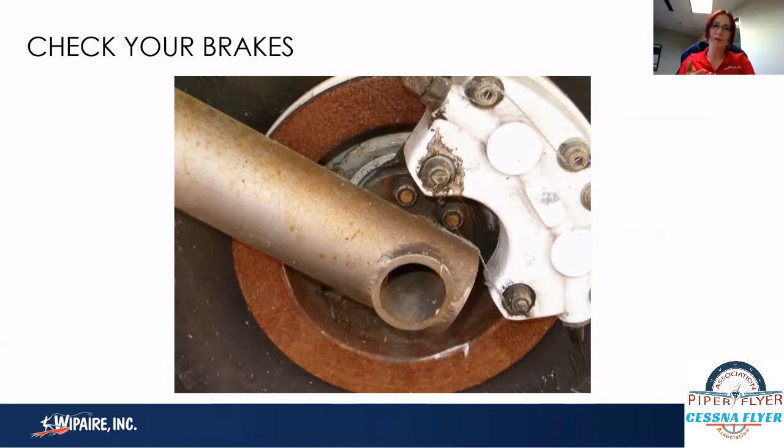There's a difference between surface corrosion that's going to wear off with the first couple applications of the brakes versus pitting, which is a deeper corrosion. There's a micrometer check — you measure with what's called a pin mic to measure the deepest spot of wear or corrosion pits, and once they reach the limit, that part should be changed. Those limits are set by the brake disc manufacturer and vary from float model to float model.